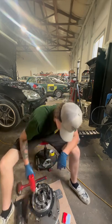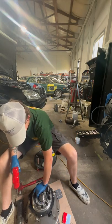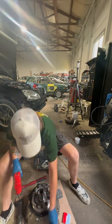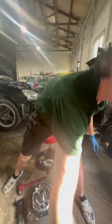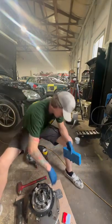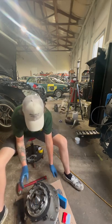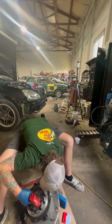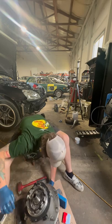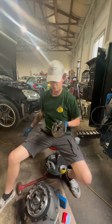So now we're gonna pull the pump out. How I like to get this pump out — you're gonna wedge the bell housing. Take something and wedge that housing up, just kind of prop it up like that. That's all you're gonna do. Then you're gonna take your T45 and just drop that pump right on out of there without it hitting the ground. And there you are folks — 722.6 transmission oil pump.